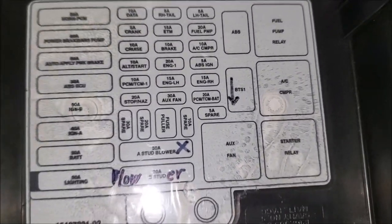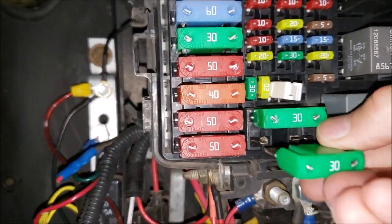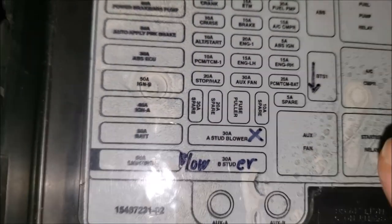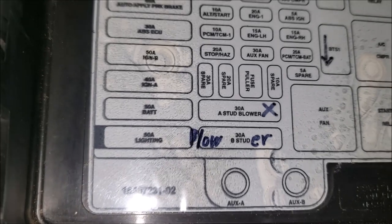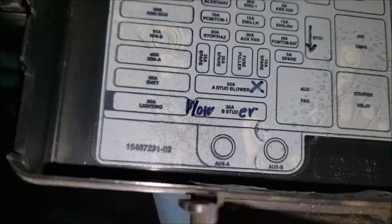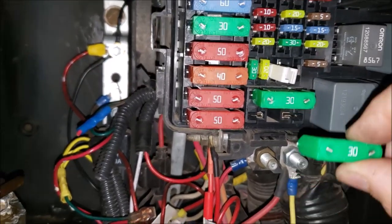Now this is the odd point — this took a while to figure out. I had one wire that was staying hot all the time, and it took a while to figure out where it was fused. It's fused right here at this lower 30-amp fuse, but it's labeled wrong from the factory. It says 'blower' by the factory, so this is supposed to be the blower fuse — but it's not on mine. What actually controls the blower is the lower 30-amp fuse, which also powers these auxiliary studs: Auxiliary A and Auxiliary B. Those are also controlled by these large 30-amp fuses.